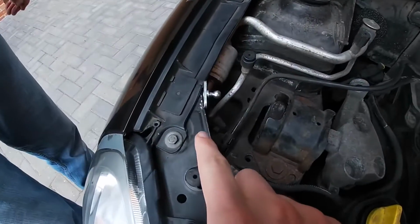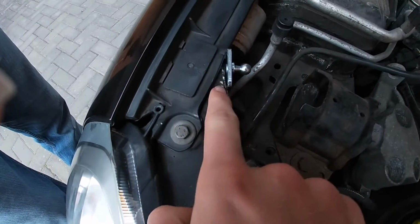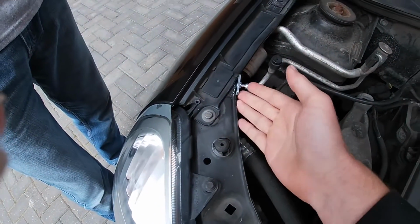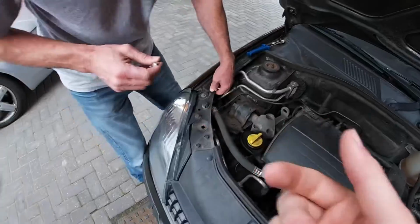I had about a 2-3 hour nap, but we're back now. So what we had to do, well, just bend this metal the smallest bit. It's not ideal, but then it fits flush, and you can bring it up so you can catch the thread. I don't know if that makes sense to anyone, but basically the nut, I couldn't catch it on the thread, so you just had to adjust the smallest bit. I don't know if it will be the same on the other side, because no cars are the same, but yeah, it's the smallest bend, and now everything should work.